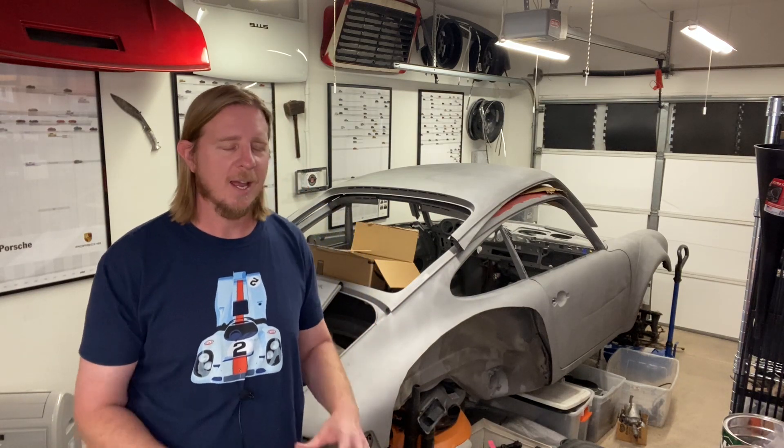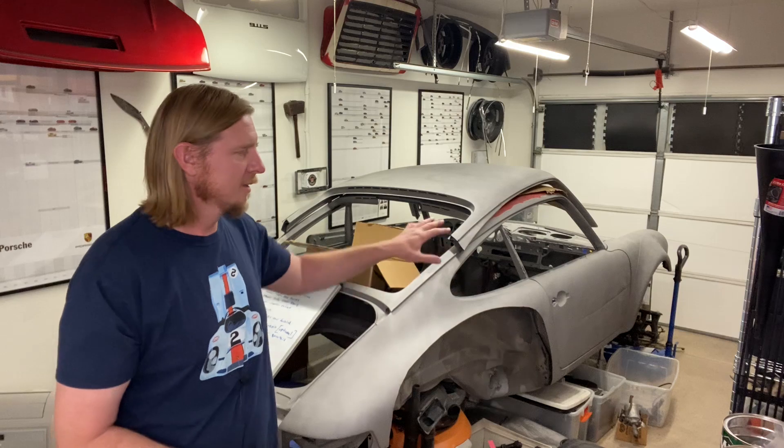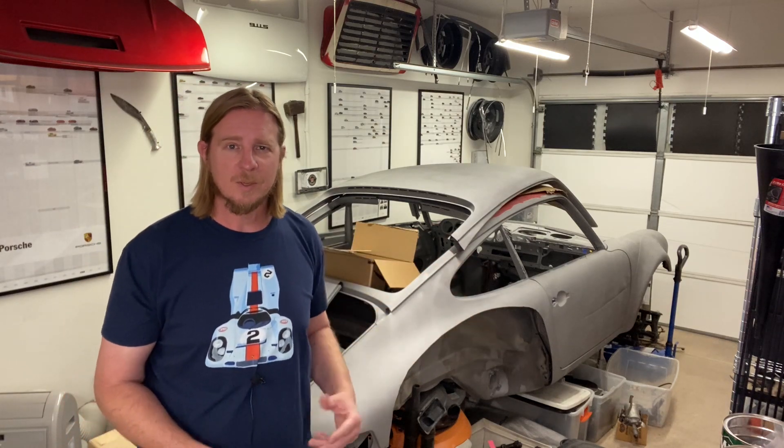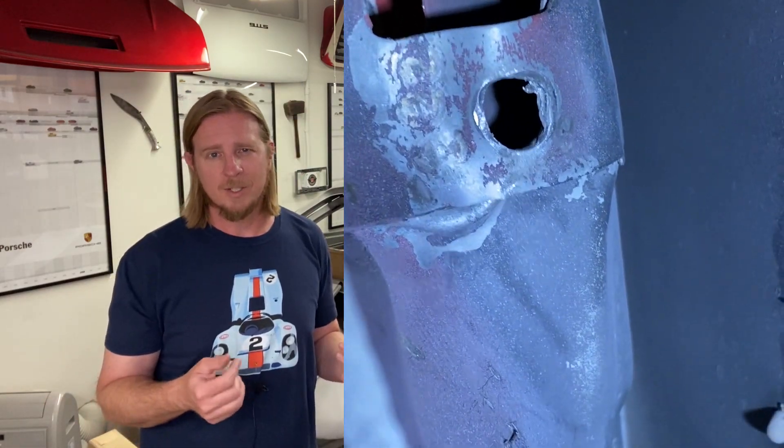It did end up taking four months, and unfortunately it's very windy here in Vegas. I removed everything from the car, including the door latches, and at some point the passenger side door was hyper-extended because nothing was keeping it closed. Long story short, this door was damaged. Coincidentally, there was some prior work done on the door which was awful — early body work where it looked like they got into a fender bender, drilled holes, pulled it out, and then just filled that big crease with Bondo. This skin is pretty much trash and the internal structure that holds the doorstop is actually folded and bent from when the door was hyper-extended.